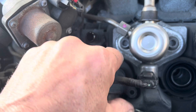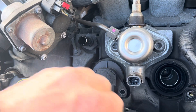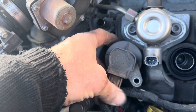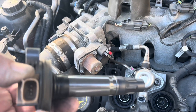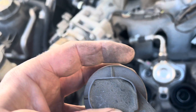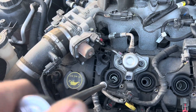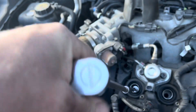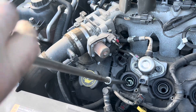I'm going to unplug this wire connector as well, remove that, and then I can pull that straight out. Sometimes you've got to spin the coil because it will interfere — it might hit something — so spin it a bit and boom, it comes out. It looks not so bad. I don't see any tracing. Look for green corrosion in there as well. I don't see anything like that — that looks good. One other point: keep these coils in order. Don't mix them up. I always put everything exactly where I find it. If you feel resistance and it doesn't want to move, you might have to spray a little lube down there.